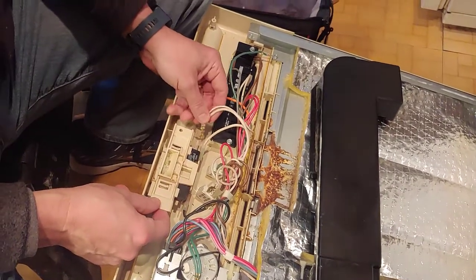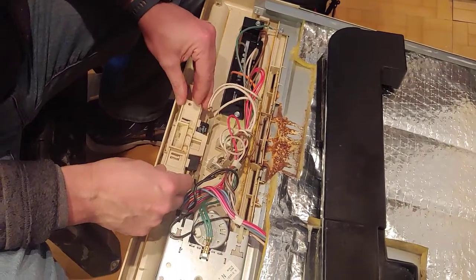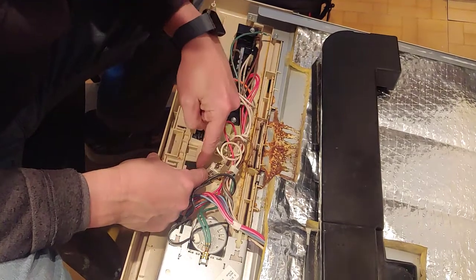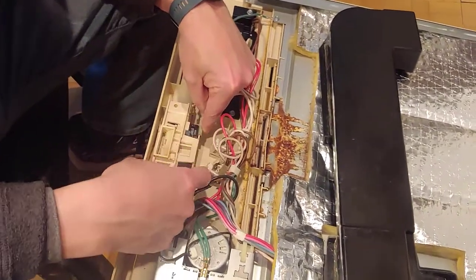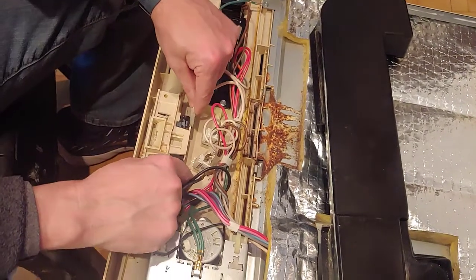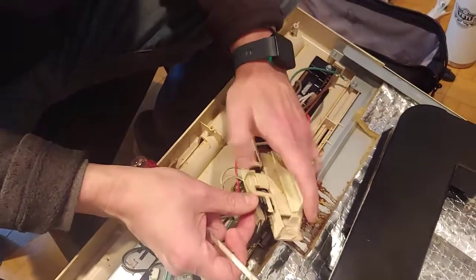The problem we're facing is these micro switches are loose from overtime and may need to be replaced. I've taken one screw out because it comes off with the cover. What we'll do is temporarily wedge something under these micro switches so they make better contact. We're also probably going to order some new micro switches and just replace these so they'll work like new.